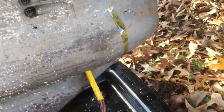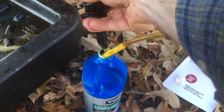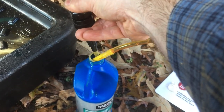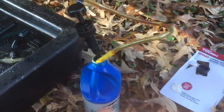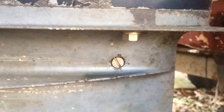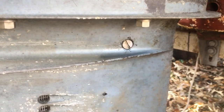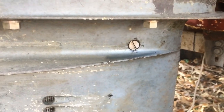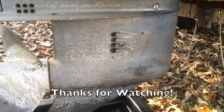We remove the bottle assembly from the bottom and put the plug in. I picked up the valve and put the other end into the bottle so I'm pumping air through the line to clear it. Keep this gear oil saved separately — it's stinky stuff you don't want using for other projects; store it with your boat things. Now you can see the drain plug is in the top and the drain plug is back in the bottom. I'm going to wipe them off really well to make sure they're not seeping oil. Mostly this is for winter — if I take it out a few times in the spring and still see milkiness, I know there's something else to fix. But now we know there is no water in our lower unit while I'm winterizing the boat. Thanks for watching.